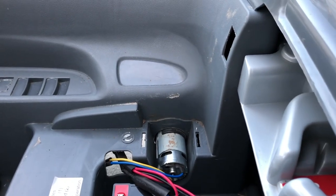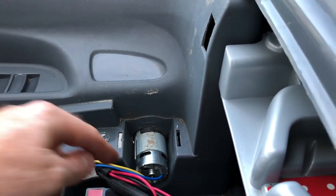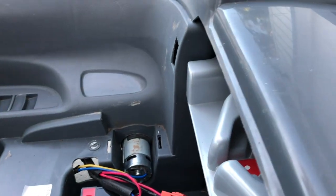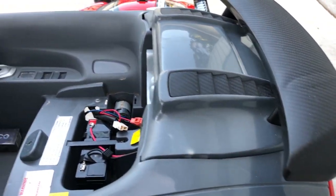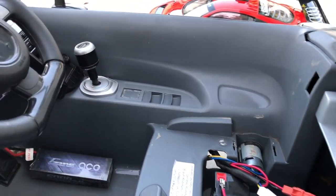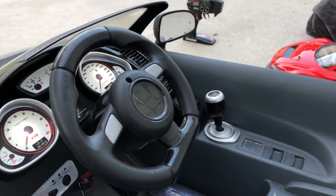I've seen other people, and I've done it before too, where you can put 12 volts to this. It's going to put a lot of stress on that poor little thing — not so much the motor, it's the actual transmission. This is only a one-wheel drive, so if you put a lot of power to it, it's just going to spin that wheel or break that little transmission. So I'm just keeping it simple, but really fun.